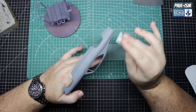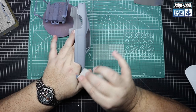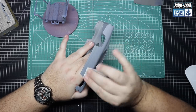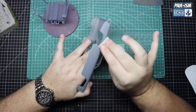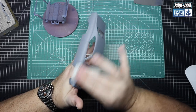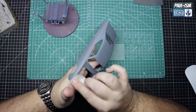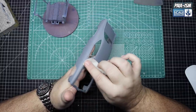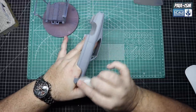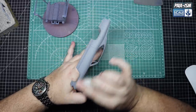No real pressure here. You could use this wet but I had to use it dry because I'm going to paint straight away after this step - I don't want any remnants of moisture. So use it dry and change or turn the paper as and when needed. Quick visual inspection to check anything's been removed. Take your time especially on edges and corners - don't go too rough or you'll burn straight through and have to pop another coat of primer on. Preparation is key - it's another step to achieving a better finish.